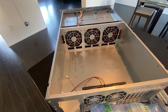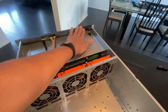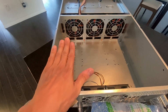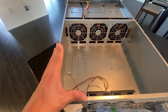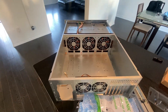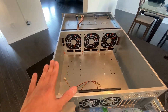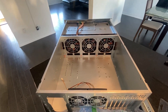The first thing we're going to need to do is obviously do the same dremeling out and cut these things off to make it flush. Then the next thing is we need to get the power supply. I'm going to be swapping out my Chia power supply, which was the 750 watt, and putting that in here because we're going to need a GPU in here - we might even need two GPUs, and the 750 watt should be okay for at least one 3070. For my Chia node I don't need a 750 watt, so I'm going to replace that with a standard 600 watt power supply that I have.